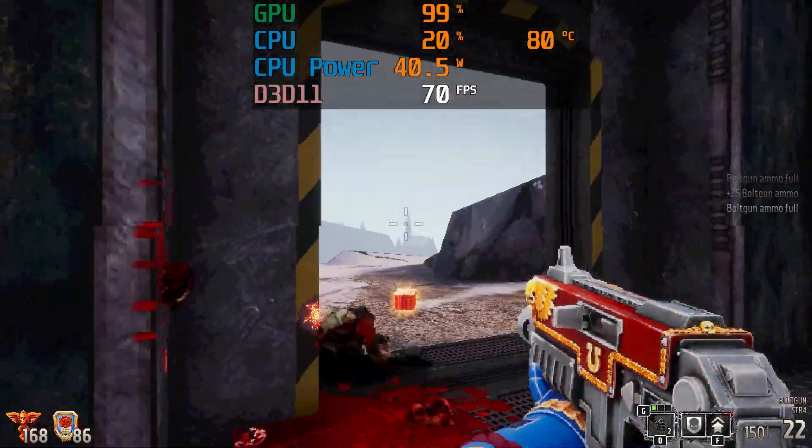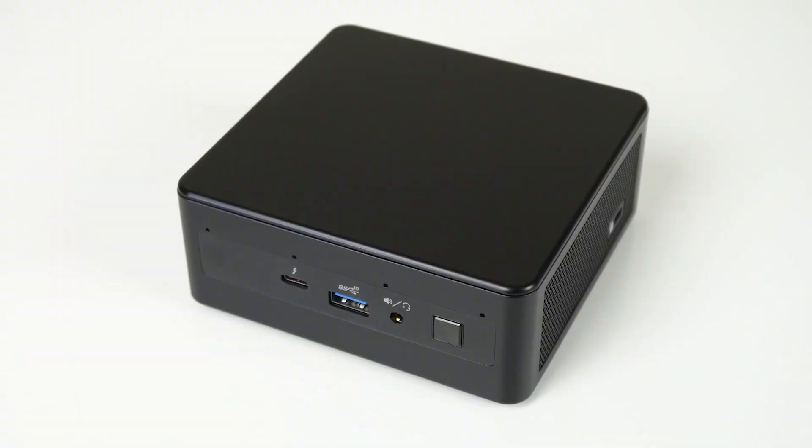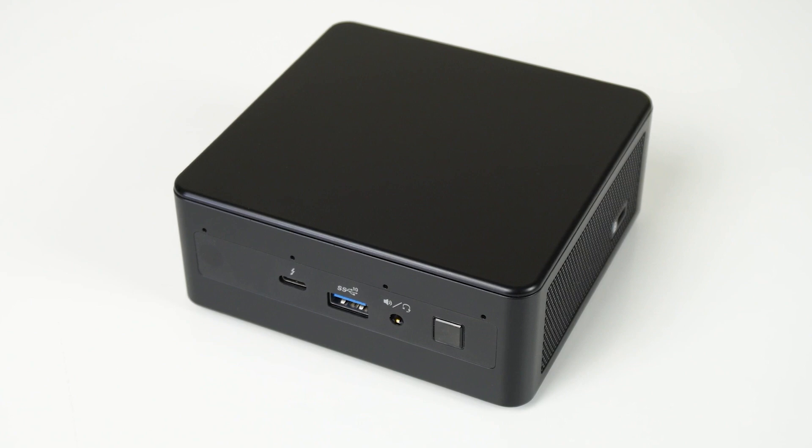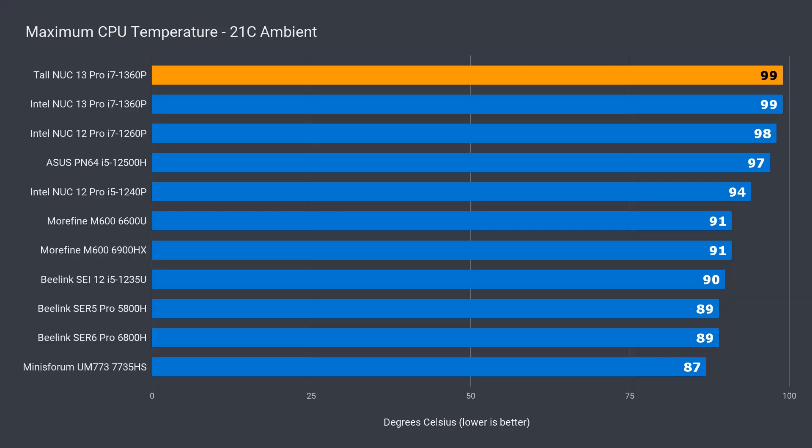I don't think this game has enough ketchup. You may remember a few years ago Intel NUCs had a metal chassis — anecdotally it seemed like the tall unit had slightly better cooling due to more surface area to dissipate heat. Unfortunately I never had the chance to test both a slim and tall with the same CPU side by side, but I've done it now with the new plastic models. And I can tell you the tall version came back with the exact same max CPU temp of 99°C, at which point thermal throttling kicks in and some performance drops.